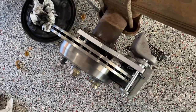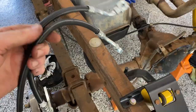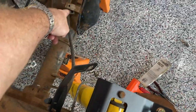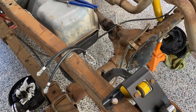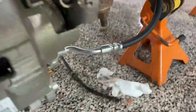What I need to do now is work on the brake lines. There are a couple of lines that will go to the calipers, and then I've got the main line that'll come off the hard line from the front of the truck, mount to the differential, and then I'll have to go to the store and get some brake lines that already have the fittings at approximately the right length to finish that up.